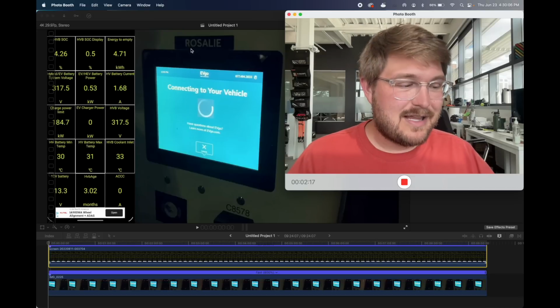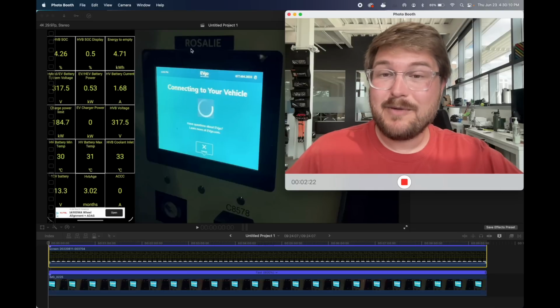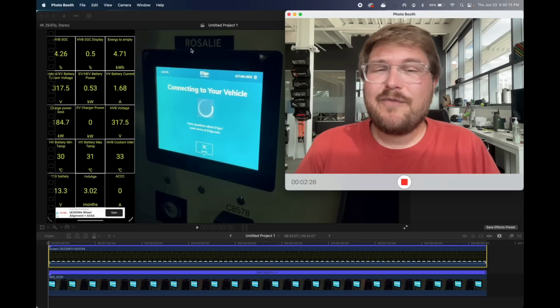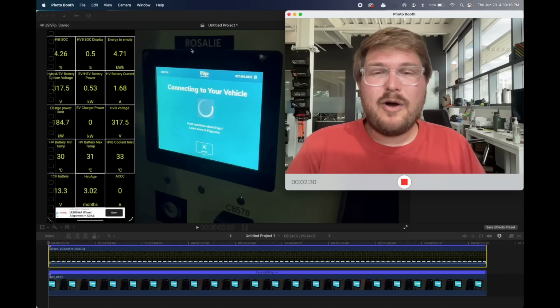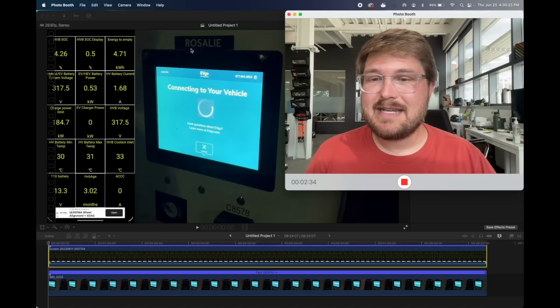That requires a little bit more testing, because some 150 kilowatt branded chargers do output more than 350 amps, but not many. And this truck requests 470 amps peak, almost the full 500, that most of the time only 350 kilowatt stations can output.